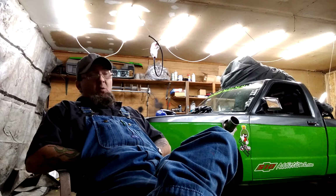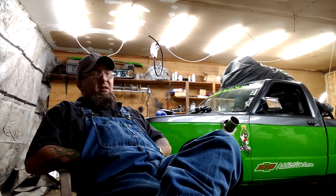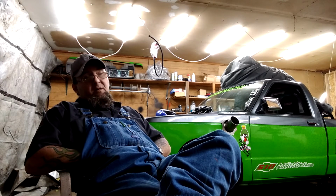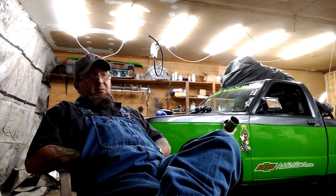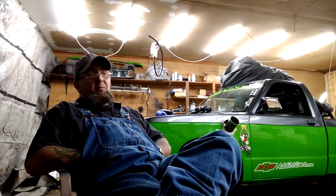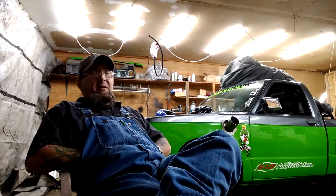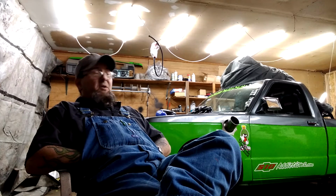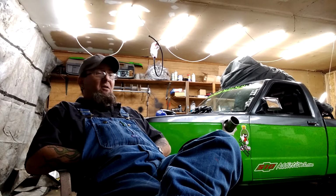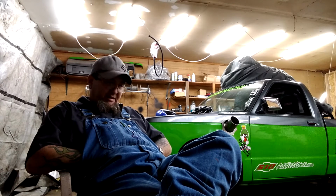This radiator's just a Champion 4-core S10 swap radiator. Then I've got a 27 by 7 by 2 inch silicone intake systems air to water intercooler radiator that's running off the heater core fittings. It comes from underneath the thermostat through it and back into the top hose to go through the main radiator. It's got an MSD remote water pump, all -16 line fittings, feeding the block and the pump and the radiator to the pump, and -16 flows just fine. We drove this thing during the summer, 95-degree heat, and beat on this and drove around the block 4 or 5 times, and it never got over 180 degrees with 180 static.